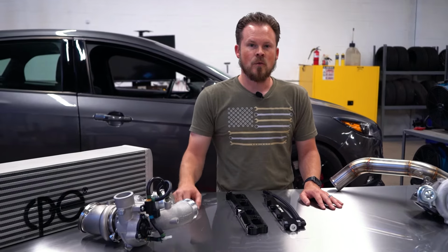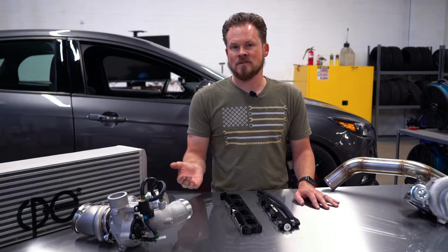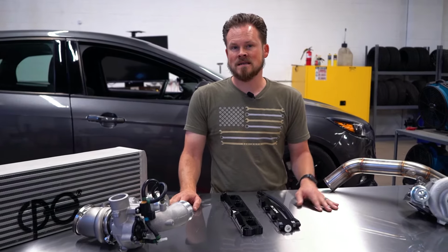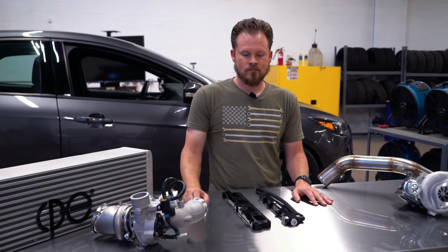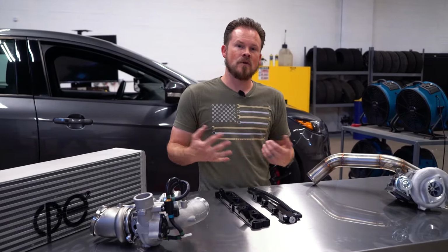You do have to tap into your wiring harness, and that can add a few extra steps that trip some people up and cause issues, which is why I feel like the XCI system is a bit more reliable, because there's less pitfalls, essentially. Now, if you're going with a 4-port AUX fuel kit, you can run higher ethanol blends.